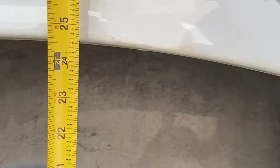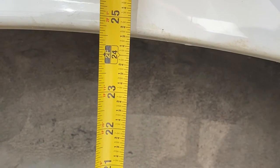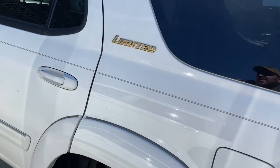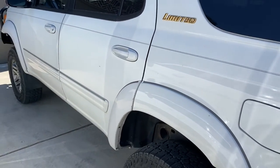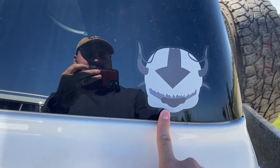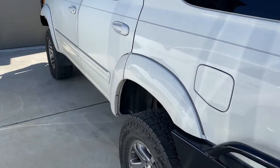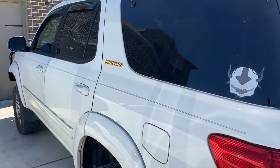It has been a few months with the rear bumper installed on the Sequoia, along with the rear suspension. I'm going to measure the height from the center of the hub up to the bottom of the fender. It's about 24 and a half inches, which is just perfect for what I was expecting with the weight of the rear bumper on it. I've also added some sound deadening insulation, which is pretty heavy as well. This is Appa from The Last Airbender — that's what I named my Sequoia. Super reliable, gets me out of tough situations, just a great little vehicle.